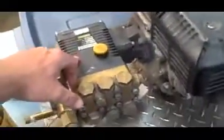So to get 1,200 hours out of a motor, what I pay tribute to is changing the oil in this pump about every 3 months. To rebuild this, you're looking around $600 if you have it professionally done. So I definitely recommend just take care of your stuff. Change your oil about every 3 to 4 months. Same thing on a car. If you want to get a good life out of it, just make sure you keep that oil changed.